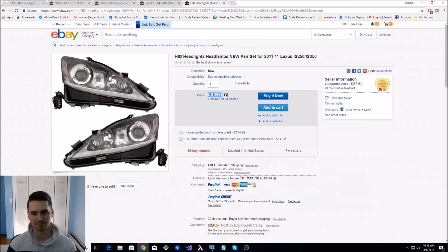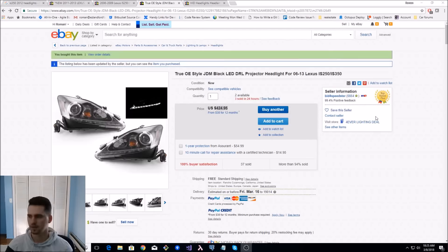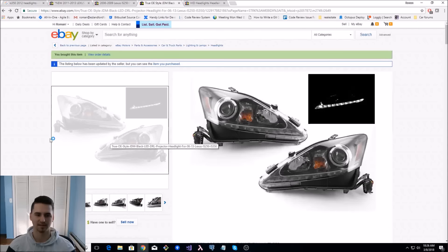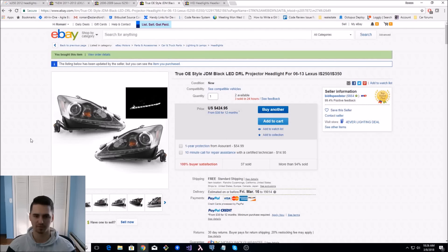The only ones — I think Depot makes ones for the HID model — but they sell them for $1,000. So there's almost a $600 difference. The main difference between these $400 ones and $1,000 ones is these have the slots for your modules that you could take off your OEM headlights, plug them right in, and they'll work with your existing HIDs. And these obviously don't have that — they just have halogen bulbs already inside them.